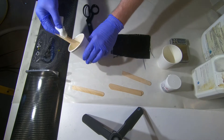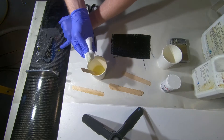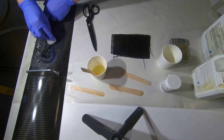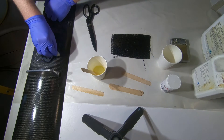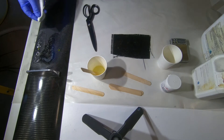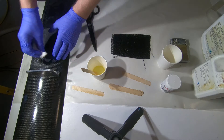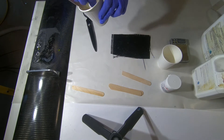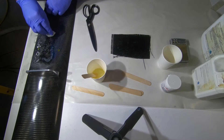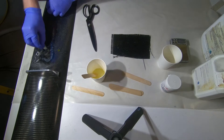As part of the preparation for this, I've laid in some wax — just little wax fillets — into the holes. That way you won't get any resin or carbon in there. I'll also just carbon over the whole thing and then grind those fillets out later. This way we're not going to get any distortion to the weave from where those fillets are — it'll just look better.